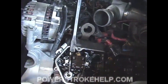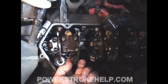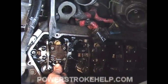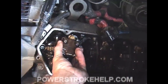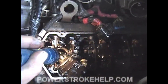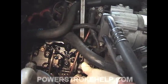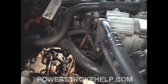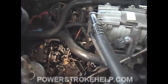What we do is lift the collar up and slide the crowbar underneath the collar, just like that, and then pry it up. Out the injector comes. Now there's going to be fuel and oil that go down into the cylinder — just let it flow down in there. Take a minute and let it all go down in there and we can extract the oil later.